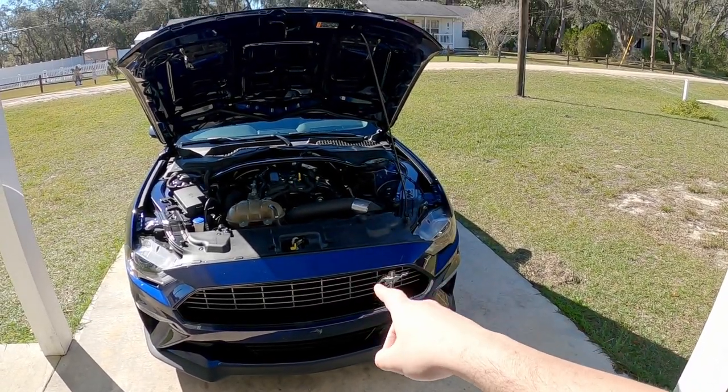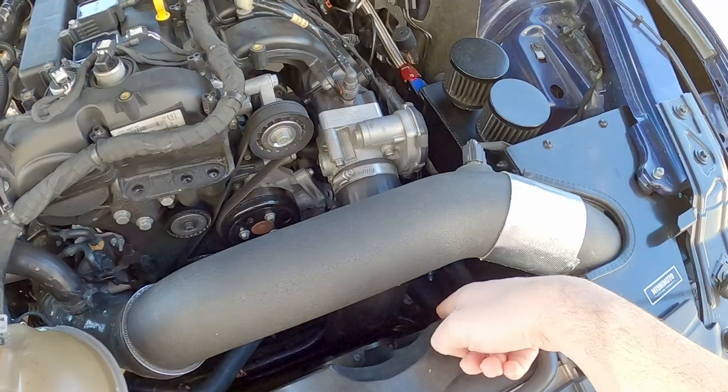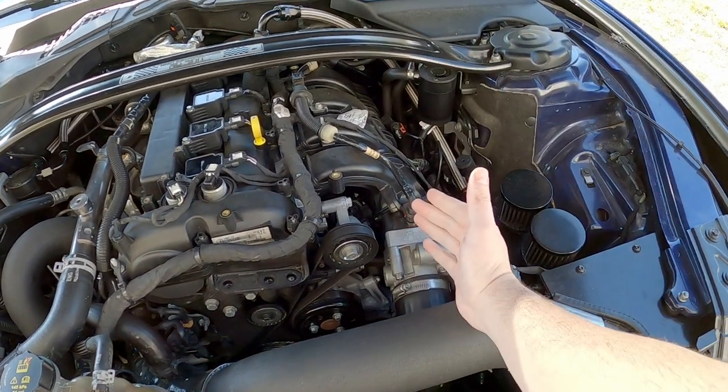I am at a loss with this car. No matter what I do I can't get it to stop over-boosting. There's a big difference between the problem I was having before I started tuning and the problem I'm having now. The fake over-boosting before was excess pressure built up in the charge pipes before the manifold, setting off the TIP sensor. The problem I'm having now is legit overboost — way too much manifold pressure.